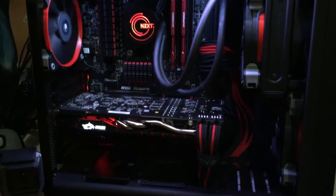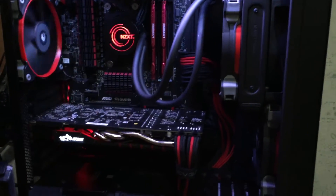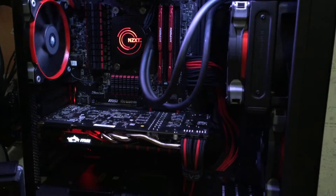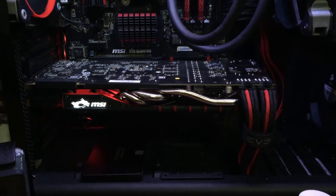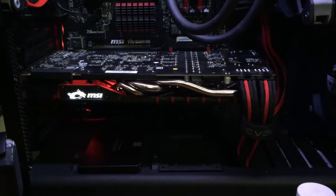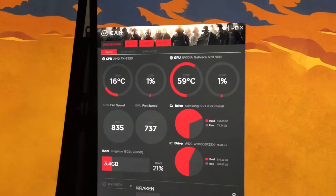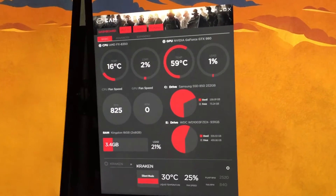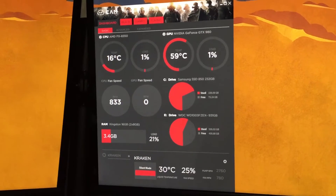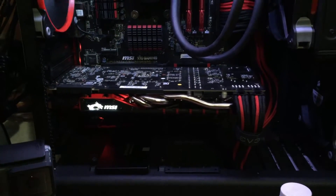This is my PC — this is a GTX 980 and my CPU is an AMD FX 8350. Yes, I know it's on the old side, but I built this in late 2015 and it's currently early 2017. The main reason I'm making this video is because this thing is running really hot at idle. Before with one or two monitors I would sit between 35 and 40 degrees idling, and now we are idling at 59 degrees, sometimes touching 60. The fans will even kick on at idle, which is ridiculous — especially with an aftermarket cooler like this MSI Gaming 4G GTX 980.